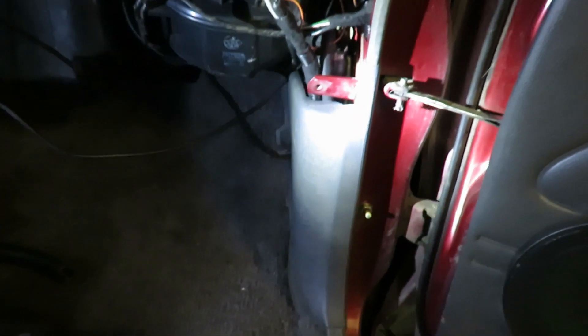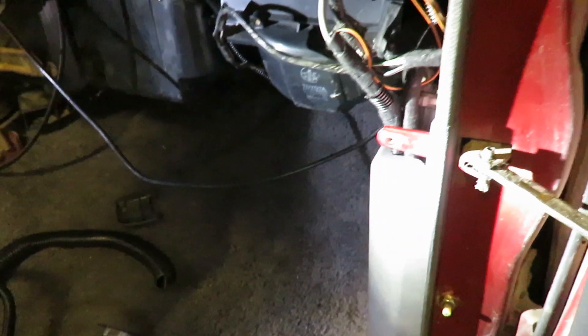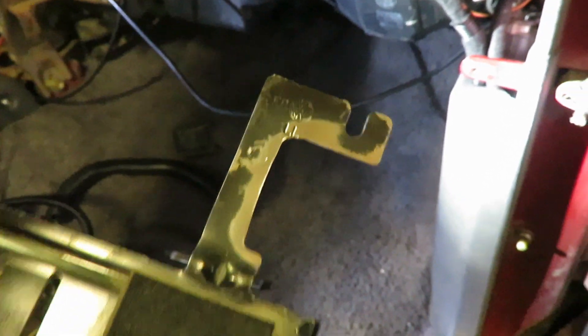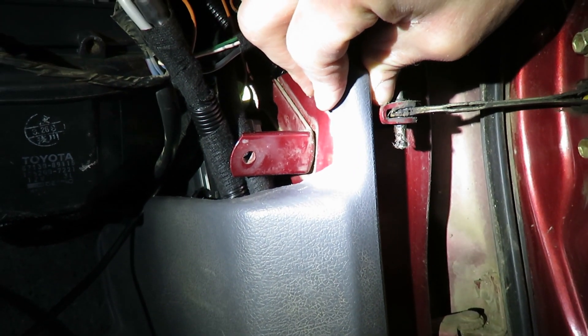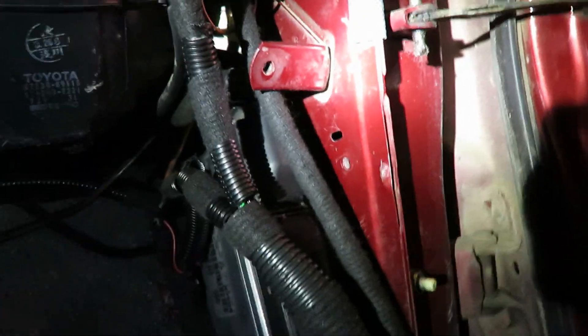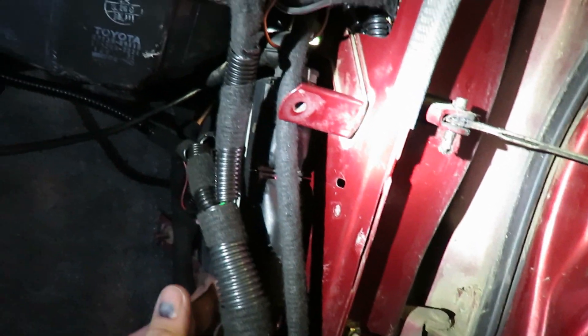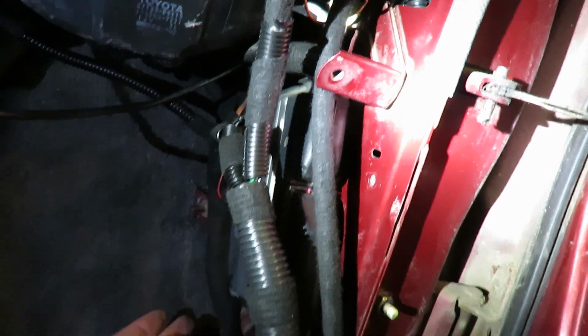After much trouble, I'm kind of semi-happy with how this ECU is mounted. I originally had it mounted on the original bracket, cut it up and made it fit, but that was before I had everything loomed and now it doesn't fit very well. It's basically held in by the panel - once you pull the panel off it's all loose, but it doesn't move around when the panel is on, so I think it should be okay. It's a really small area and it's been kind of a pain to get everything to fit, but I got it to work.